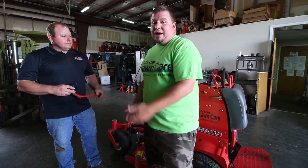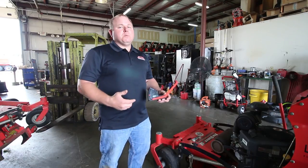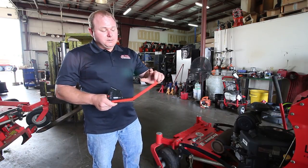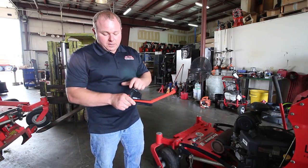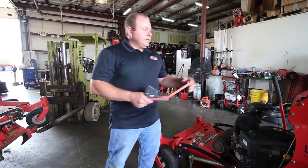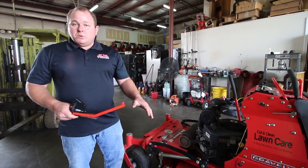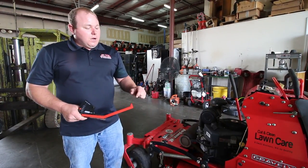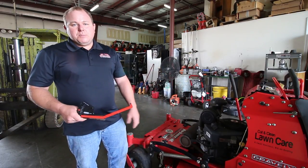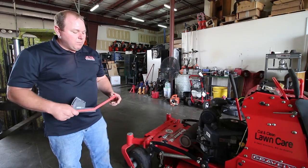This can help you guys if you have one of these Gravely mowers in the same situation. One of the first things you want to do is buy one of these — a blade or deck leveler. It's really inexpensive. The tip of the blade goes right down on it and you can see on the gauge to get it set up. I always set the deck at three and a half inches. Once it's set, make sure your tire pressures are correct — in Andy's case, both back tires at thirteen and a half PSI. The front tires are semi-pneumatics, so you don't need to check those.